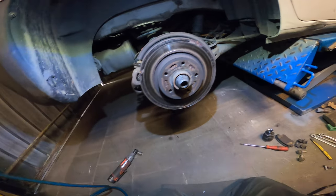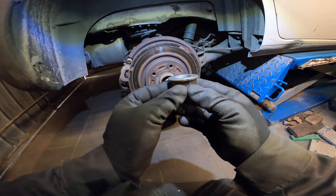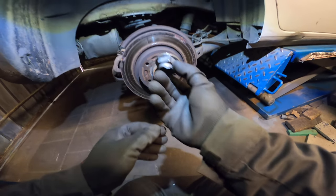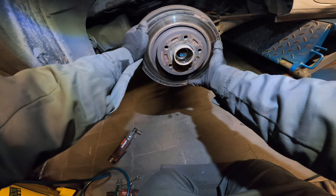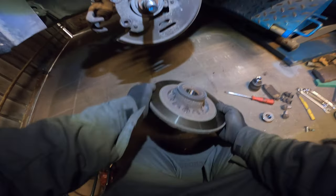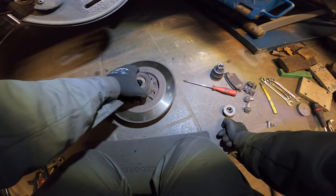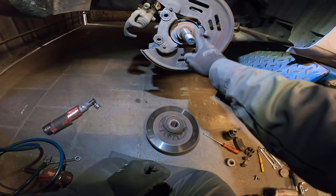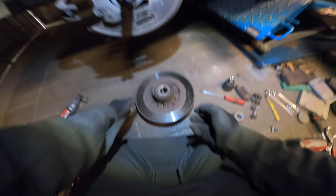As you can see it comes off at the impact. Good impact, good pressure, air compressor — we have a new one. It comes with the brake disc kit, and now we should just be able to take this off. And we are. Here we have it. This is the ABS ring. Here is the sensor. Here it counts. We're gonna clean everything up here for the new part.